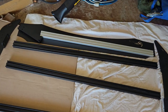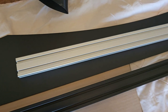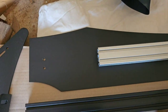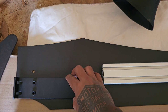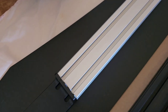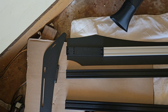When I opened up the box I noticed this piece and I couldn't figure out what it was. When I pulled out this aluminum bar — the only different colored one — that's what is going to bolt onto the windscreen. It's going to bolt on just like that, but I realized it was too short, so that's where this extension piece is going to come in. You can see those holes — it's going to line up just like that, and you put two bolts in here, and you should be good to go as far as the windscreen. The small slots in the side part of the roof rack are where these crossbars are going to get mounted, so I'll leave off the ones that would block those holes for now — I believe it's only this one crossbar — and I'll try to get this mounted onto the truck so I can target my holes for drilling.